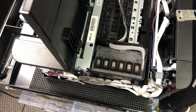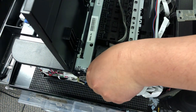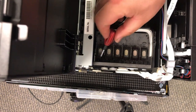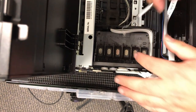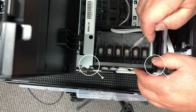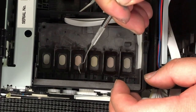Here's why we need version two — this has to be installed really tight. If there's a gap, you have to realign and calibrate your printer. There are two more screws underneath here. I've seen lots of people breaking this piece too. I usually just lift it from the middle because it's secured on the two ends. If you do it properly, it won't break at all.